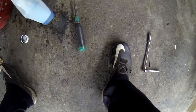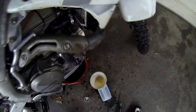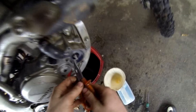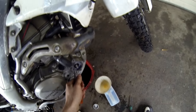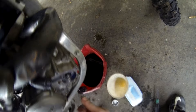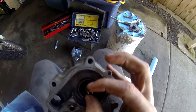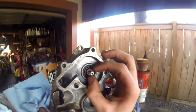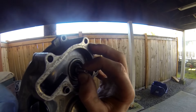If you choose this method, be really careful not to scratch the seal surface and create a permanent leak. All you do is take some needle nose pliers and slowly work your way around the edge of the seal. Sometimes it helps to take a mallet and a screwdriver and gently bend the lip in. Note that the proper seal direction is with the lips facing out and the flat side facing into your right side cover. The same is true of your oil seal — flat side facing in toward the right side cover, but not toward the engine.